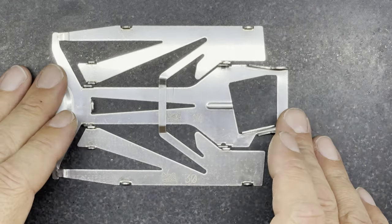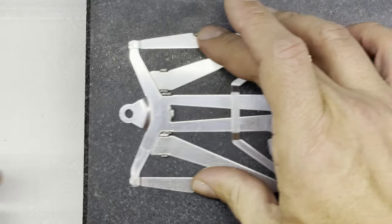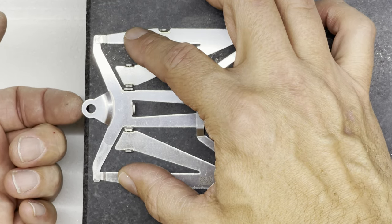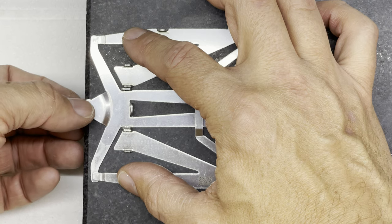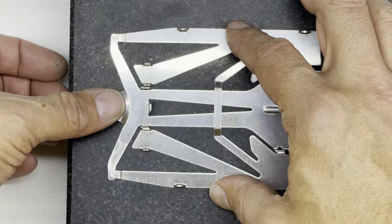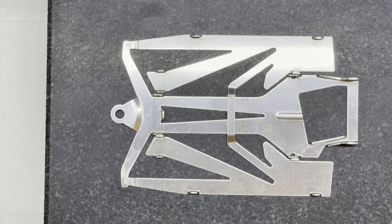It's worth checking that all the pans and center sections still sit flat and straight. Another way to check is to put the guide tab just over the edge of the block with the T-bar sitting on the block - hold the front of the pans, lift the guide tab, and see if there's any movement under those two front ears. If you've got them nicely positioned there shouldn't be any movement. You can over-bend these and find the fronts of the pans are actually in the air. I've had cars with bent pans still lapping at the same time at the end of a race as at the start, so sometimes I wonder why I bother - but in testing this does work for me.